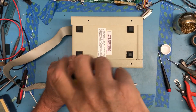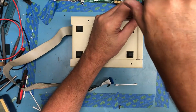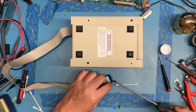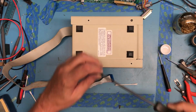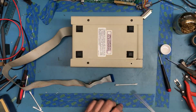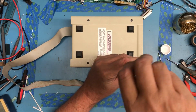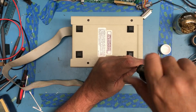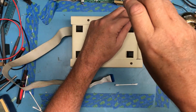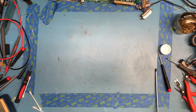Yeah, I actually found an online PDF of the ProDOS manual and have read through it. Was actually surprised to see it was a menu-driven system. I'm just so used to being at the command line. It was interesting to read how drives are numbered: slot number, comma, drive number. So slot 6, comma 1 and 2 would be the first two drives, and then slot 4, 1 and 2 would be the next two drives, or maybe even slot 5, 1 and 2. It was an interesting twist to see how this was actually done. It again speaks to that interesting architecture in the Apple II, where it's just not a bus sitting there with the edge connectors. They're actually each unique.